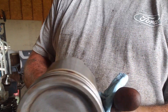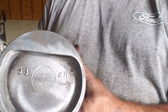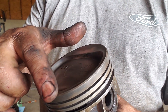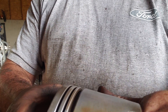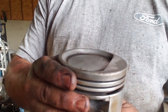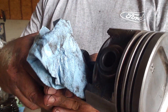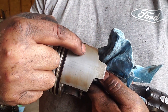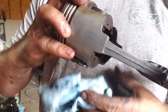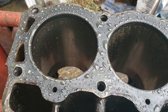There's our piston after being on the wire wheel — about 30 seconds to a minute. You can see there's still a few little chunks of carbon and the ring lands could use a little more cleaning, but I'd put that in the engine. You can see there's some scoring on the skirts but you can't even feel it — that's basically just polished aluminum. All right, you can't feel them at all.